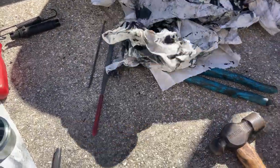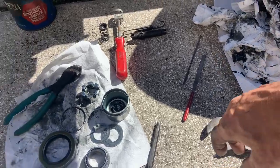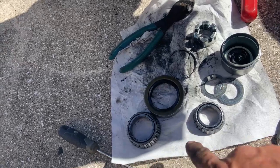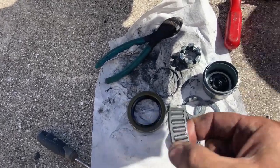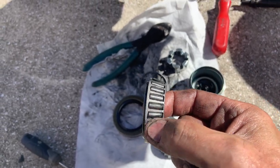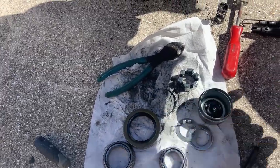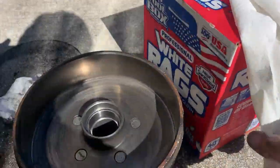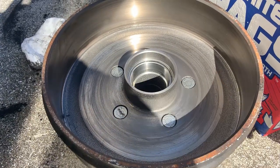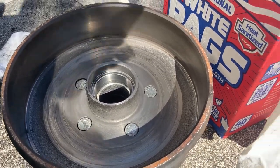There's a pretty big heap of paper towels I've used here. If I were out on the road without these resources, this would be clean enough to reassemble. I've got these wiped off well enough to inspect the rollers. A telltale sign of a bearing problem is to look at the race — if you see a mar on the race, the bearing is shot. But everything here looks brand new.